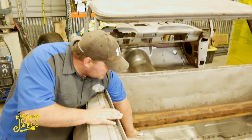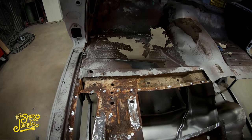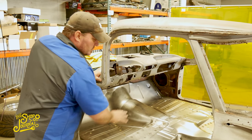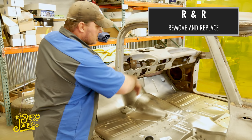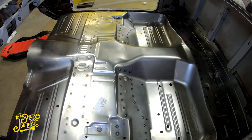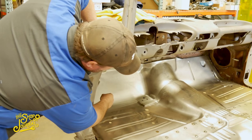I also built this bulkhead back here because the original was completely rotted out and they don't make factory replacements, so I used a bead roller to stiffen it up and get it looking good. I then cut out all the old floor, which was completely shot and rusted out, cleaned the original cross members, and applied rust preventative paint in all the channels of the cross members to make sure it'll last. Then I rosette welded in the floor — that's the second of the three pieces.